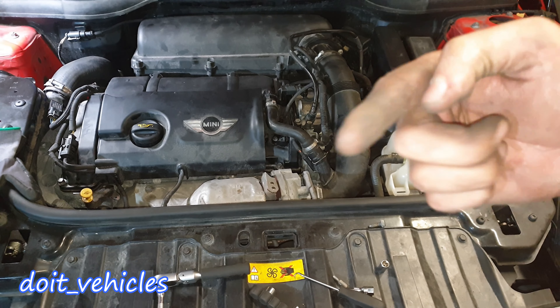Reconnect the wastegate solenoid connector now so you'll know it's done. This one is for the solenoid down here. It's important to do this step because if you forget to plug in one of these connectors you'll have to do this job again — so double-check. Place the manifold back on, reconnect the evaporative solenoid onto the bracket, reconnect the throttle body connector, reconnect the oil pressure sensor, and install back the MAP sensor. Finally, install the manifold nuts and tighten them by hand first.